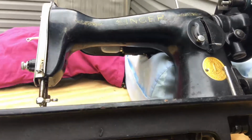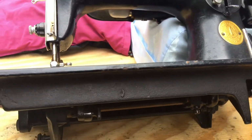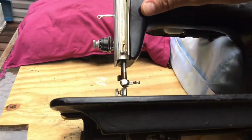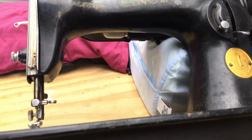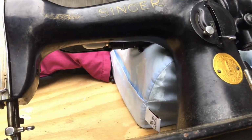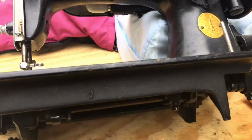Okay folks, this is Vintage Sewing Machine Garage with the next video installment of the restoration of the Singer 15-91, the ugly duckling as I call it, because it was looking dirty and kind of rough. I've used some hand cleaner, non-pumice, real important to not use the kind with pumice in it, and I used it on the finish and it seemed to clean a lot of dirt off. I've still got a ways to go, but it's coming back.